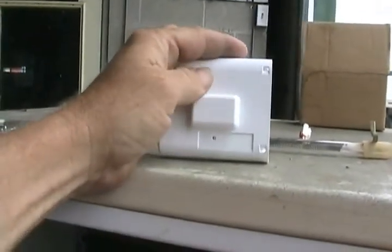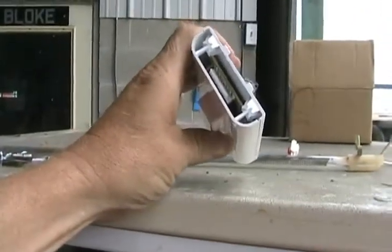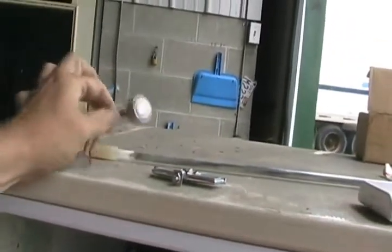Wholesale price is about $60, and retail is a lot more. So if you have one of those Maytag kind of fridges or others that has one of those things, and you've tested both the heater and the thermostat and they're good, just find this Adaptive Defrost Control board — that's your problem.